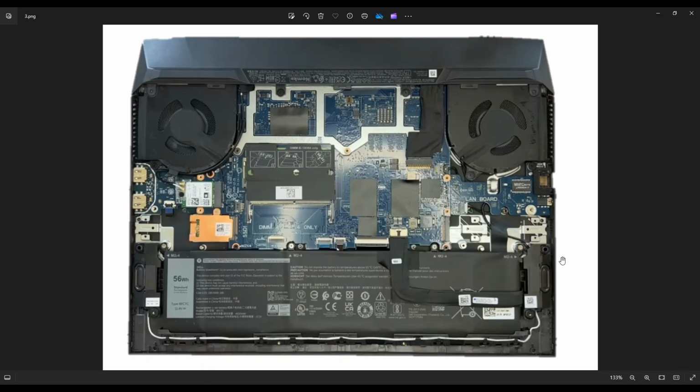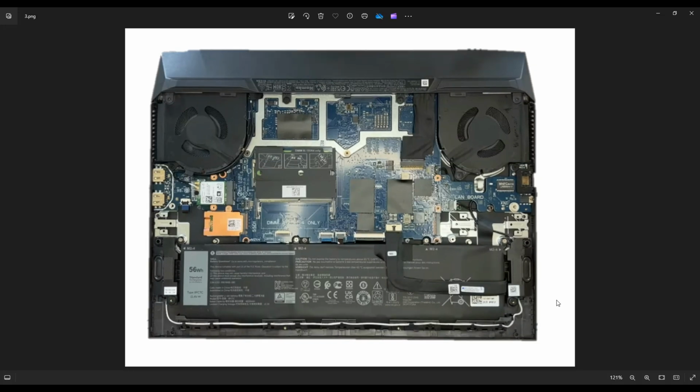Also, before touching anything in a computer, it's best to unplug your battery. This battery unplugs very easily. I held this cable here, took it up a little bit, and I took a pry tool and this black ribbing right there on top, I gently pushed down on that with my pry tool at the same time that I gently pulled down on this cable, and the battery unplugged fairly easily. Okay, so now that the battery has been unplugged, we're safe to proceed deeper into the computer.